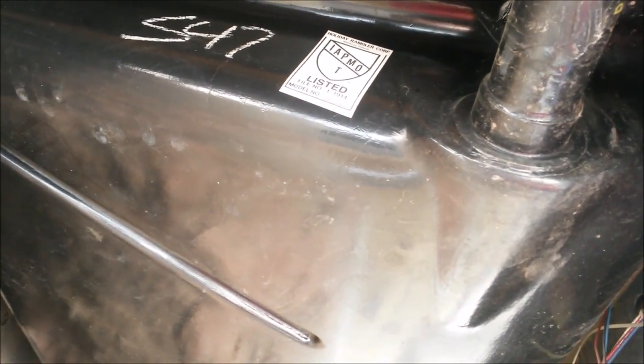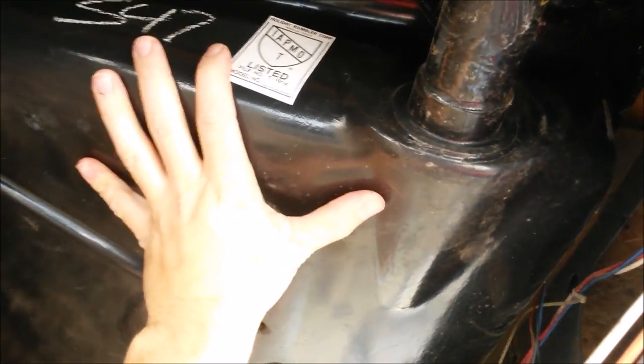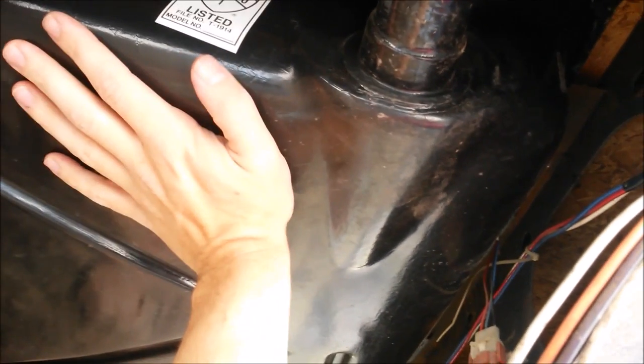All right, in this video, I'm going to show you guys how to repair a leak in one of your tanks. That's an ABS tank. That's going to be your black or gray water tank. This is the kind of leak that no one wants to have to fix because I'm going to have to drop the tank. If you have a crack that you can get to, either by removing your underbelly or getting through an access panel, if you can get to the leak, you don't have to drop it,